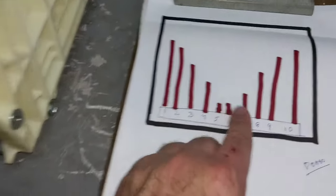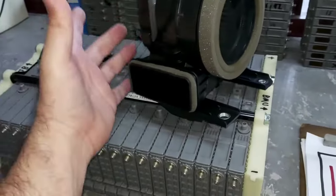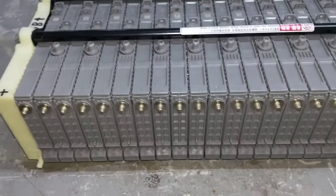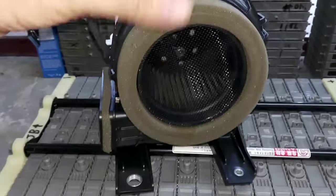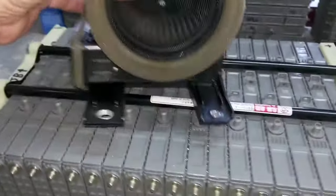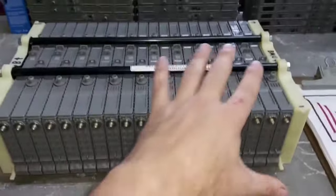This is happening to many 2015, 2016, 2017, and even 2018 vehicles that have never had their hybrid system serviced. Here we have the battery cooling fan — a very common issue. Heat, debris, and dirt accumulate on the blades. Especially in Asian markets like Thailand and Pakistan where there's a lot of dirt, people with hybrid vehicles don't even know there's a cooling system for the battery, and you see a lot of floor mats blocking the air intake.